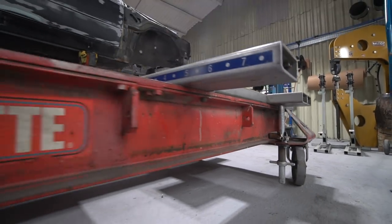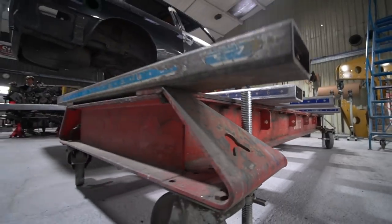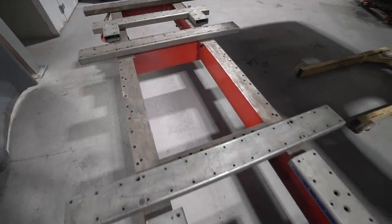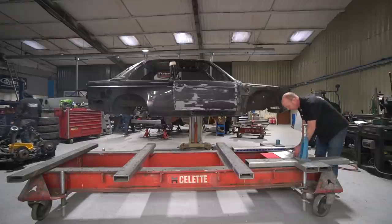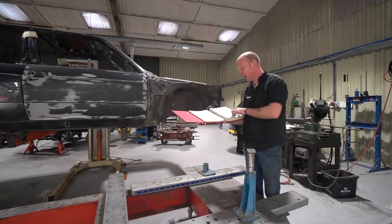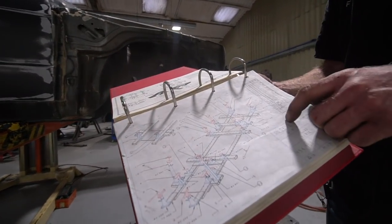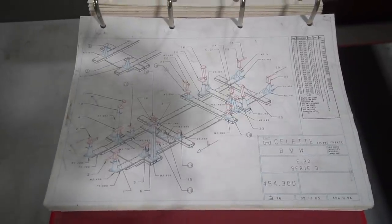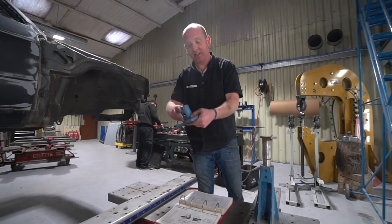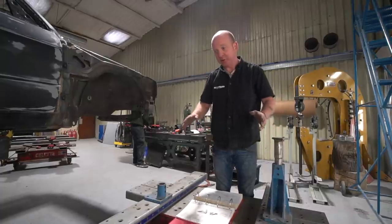Coming back to the Select-type jig bench: you can see one in front of us, we have two more over there. The basic mode of operation is that you have the basic chassis — the red bit here — which is two beams welded together, all quite substantially held together. Onto that you bolt these beam sections, which we have a number of on top. These bolt onto that frame in a number of locations. Select provide a manual showing a variety of positions where all their subsequent parts can bolt onto that frame. This is the frame drawing for the BMW E30 which is going to be fitted to this jig.